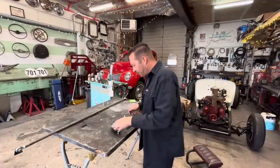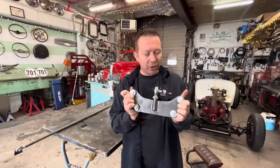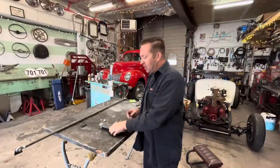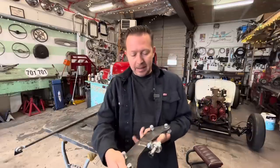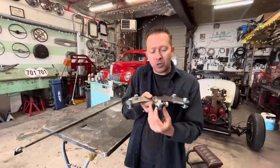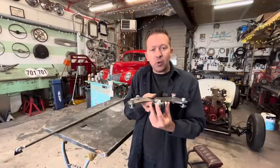That's part one. Part two, we have this piece here. This is a separate part, different part number. You gotta order this separate if you were to buy this. So the torque tube, the long tube that Jim took off that exposed the drive shaft, that's where the wishbone's originally mounted. Because that tube is no longer there, it's gonna get replaced with a drive shaft, there's nowhere to mount the wishbones. That's where this comes in. This piece bolts to the X member in the frame, and then the wishbones will mount to here. And that gives them a spot where they can attach to and pivot.